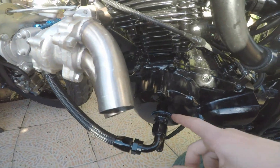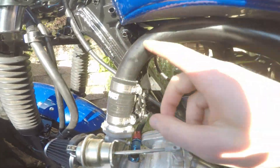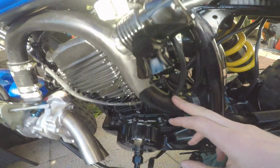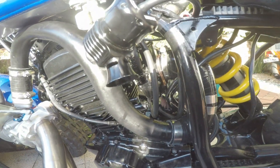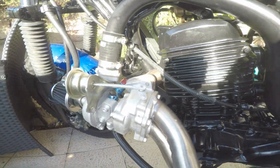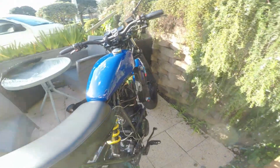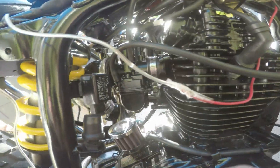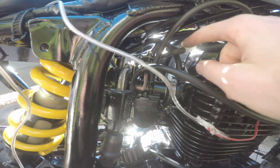This return line goes from the center of the cap here, with some aluminium pipe for the boost. It goes through here to some elbows, then there's the carburetor — it's got a blow-off valve. To get the carburetor working with the turbo, you have to pressurize the bowl.